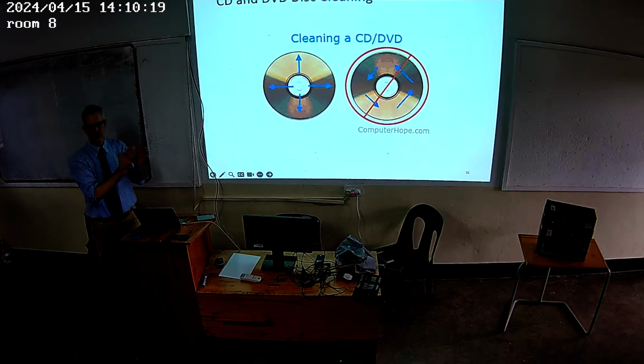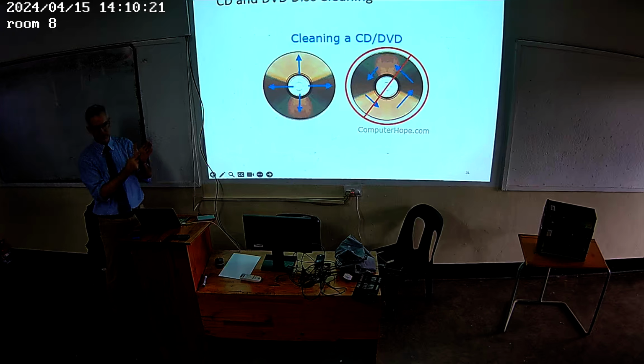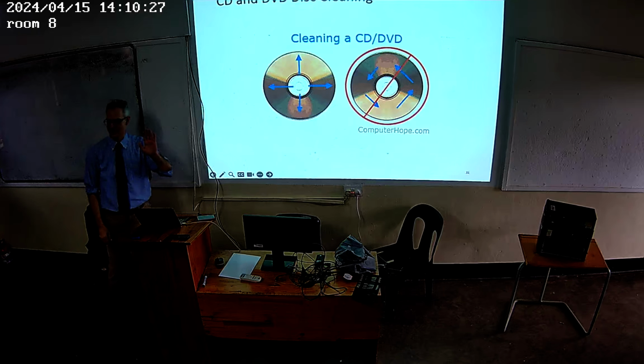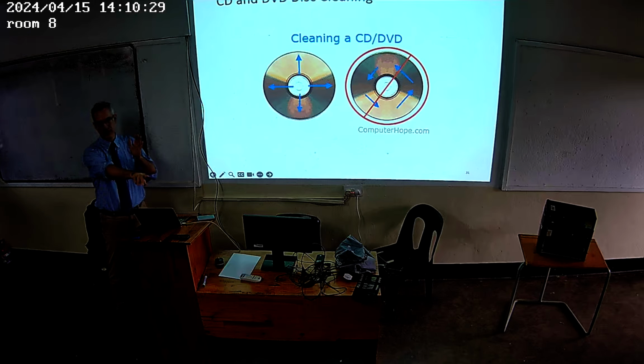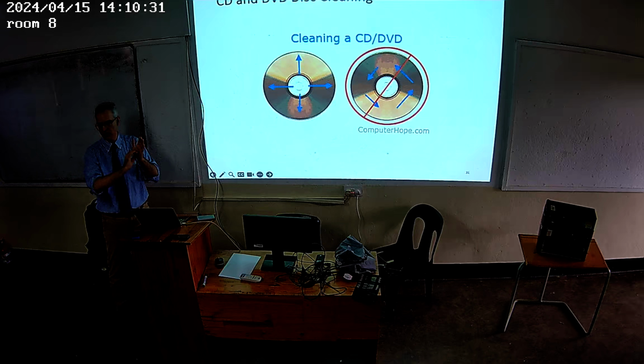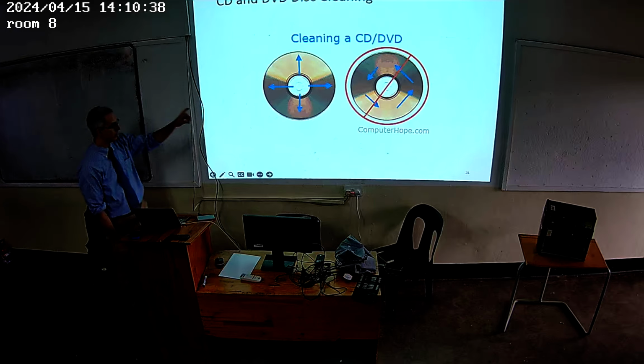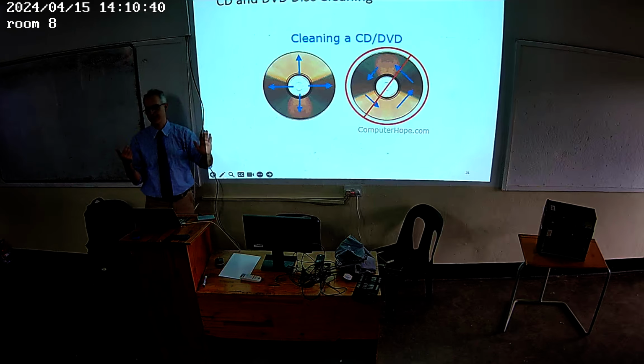When you go around and around, what are you doing? You take a particle and you scratch, scratch, scratch, scratch. Now you have a very damaged disc. But if you just go straight up, then you might get a little scratch, but then it's gone. You actually get it off of the piece. So when you're cleaning this, always from the inside out, in a straight line, never in a circle. It feels weird, but it's actually safe.